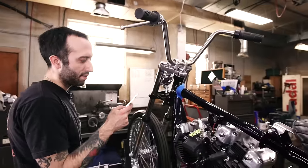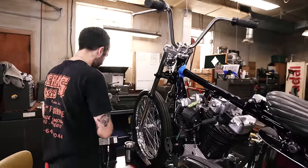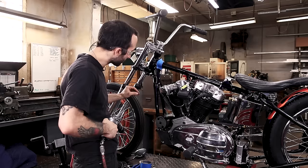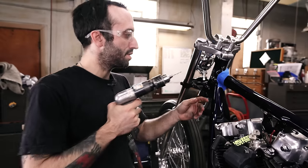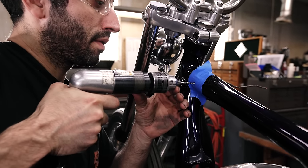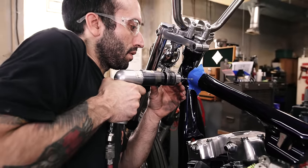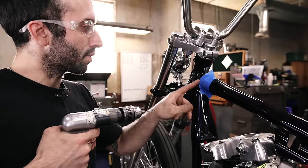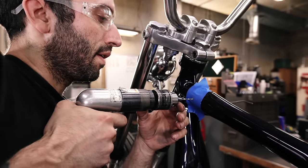Okay, we're going to put a 6-32 little bolt in there, and the tap drill is a number 36. So I put some masking tape on there just to try to control any paint chipping as much as possible and keep it to a minimum. And we're drilling for a 6-32, so I got my number 36 drill. I'm cleaning the chips off the drill so I can tell that I'm still drilling in and it's not just stuck there, just rubbing.